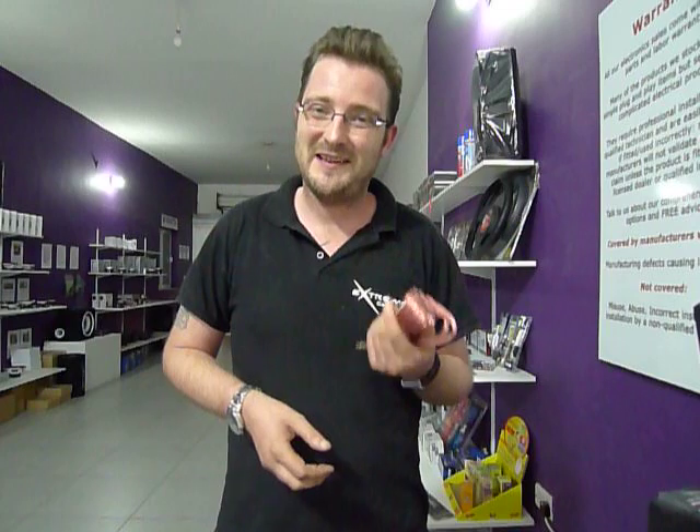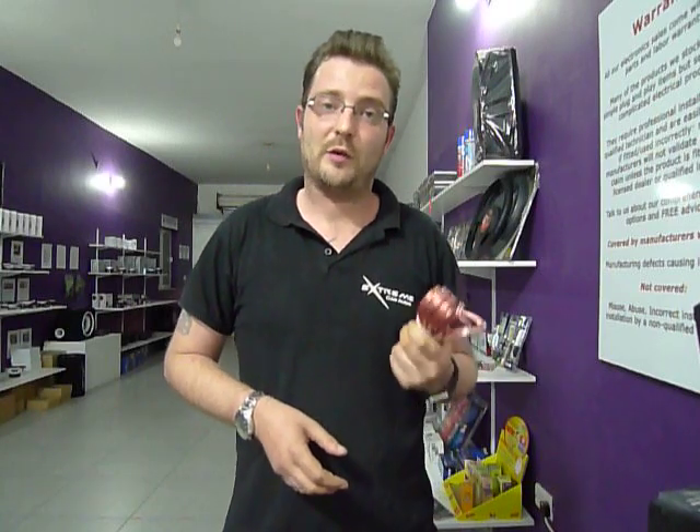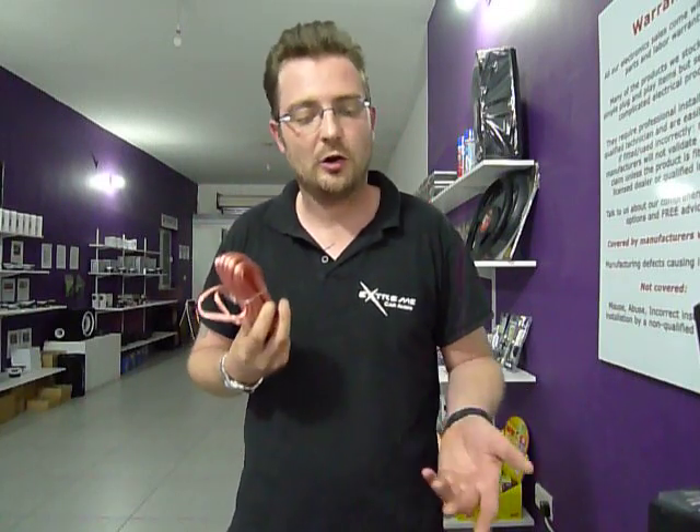Don't treat car audio like home audio. When you buy your home hi-fi, it comes in one box, all the connections are inside and very short — they're already done for you. When you buy an amplifier, you're buying a raw component of the system, and you need to make sure everything you add is the same quality. If I bought a 300 euro amplifier and plugged it in with a set of these basic RCAs, I would not be doing the amplifier justice and I'd be creating a real risk of a choke point. On the other hand, a 60 euro amplifier — this really is the right RCA lead to use.